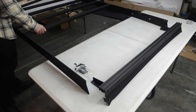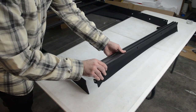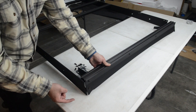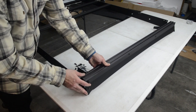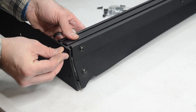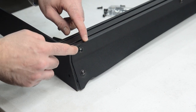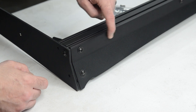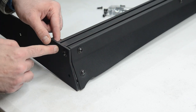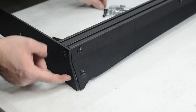I've gone ahead and thrown in four of these crossbars. Before we go on, next up we're going to go through and attach this rear valence which we assembled earlier. Essentially with this we're also going to take two bolts on each side and drive this into the crossbar itself. After that, we'll use the provided hardware and attach it to this little L-bracket. Just like the crossbars, take your little bolt washer and throw these bad boys in. Everything hand tight. One thing I'm going to mention is that I initially tightened this valence down, so make sure you loosen this so you've got some play in here just to get everything flush.